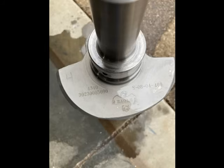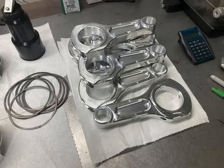And we coupled the crank with a pretty eclectic group of parts. So let's look at the connecting rod. What you're looking at there is a set of R&R custom aluminum rods, and I had these made with a small block Ford rod journal, like a 302 289 size, obviously, for the Eagle crank, and a .927 wrist pin diameter and a 5.700 length. So pretty long for a 3-inch stroke. It makes for a really short piston, which is good. Makes for a light piston. The rods were really, really light.